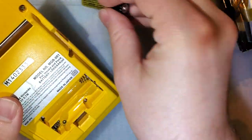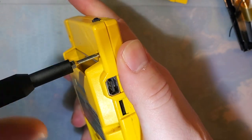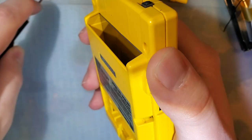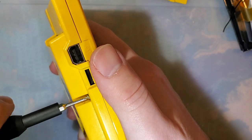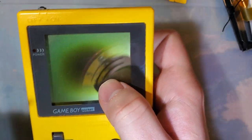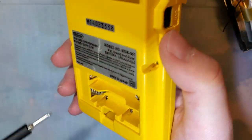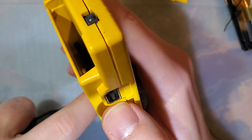So what specifically is happening that's causing this black spot is the adhesive under the polarizer layer on the front of the LCD is basically going bad. UV light, heat and moisture kill all things over time. And I'm not sure which combination sets this off, but either way, unfortunately, all Pockets are subject to this. Just a matter of time. So, if you can, try not to store your Pocket in a windowsill.